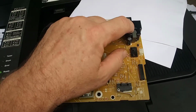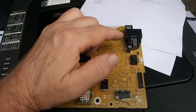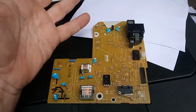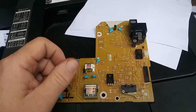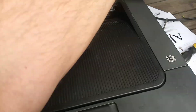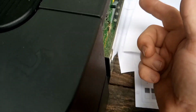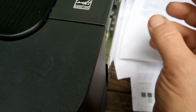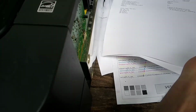What's that mark on there? So we've probably got a high voltage leak there from cockroaches. And high humidity. It causes the copper winding that's in here simply to corrode, and then it goes open circuit. If you want to extend the life of this circuit board, you could possibly put in here one of those cubes of silica that absorbs moisture, stops the board from getting humidity on it.